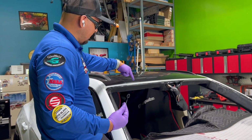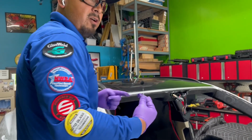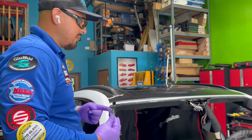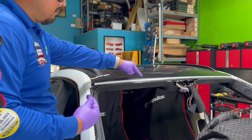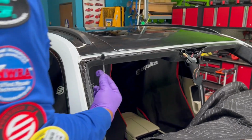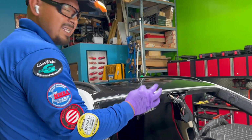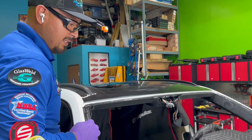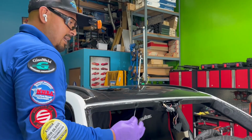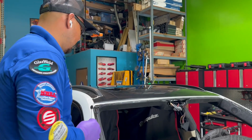Number two, nobody's perfect, nobody has a perfect cutout. We all tried. I can't say that every single cutout is perfect. Sometimes I go too low, maybe under the urethane, because the blades are sharp. We are using metal blades to remove the urethane. Just prime it. Simple as that. Prime it. And especially if we went too far down, gotta do 2 coats. It's only about 4 or 5 minutes of your time to make this very, very safe.